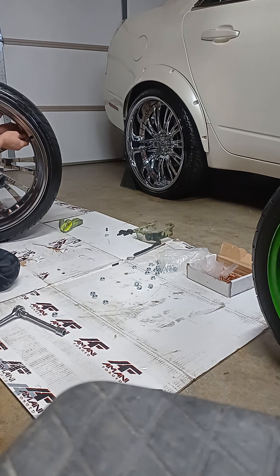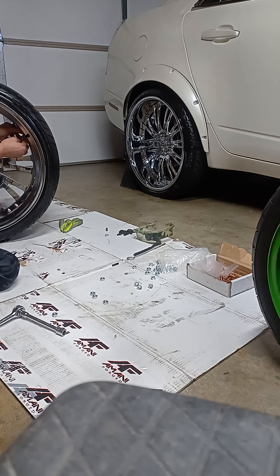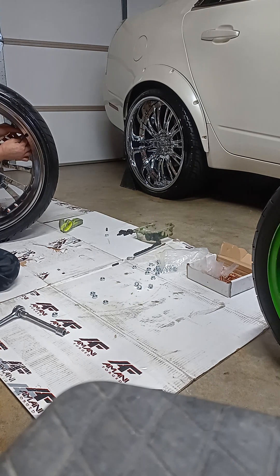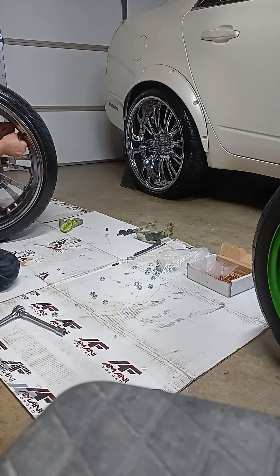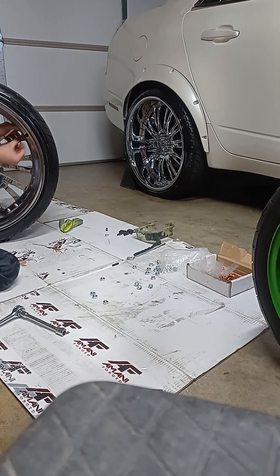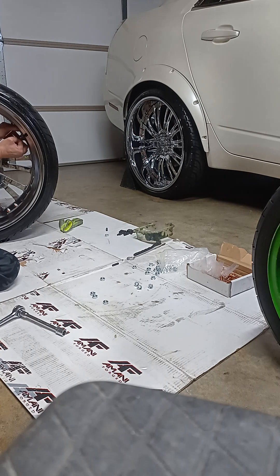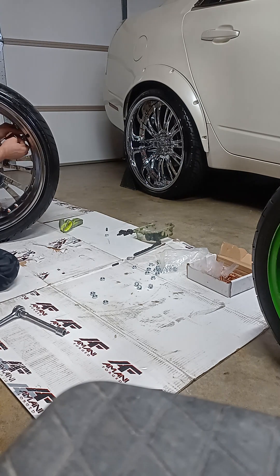These are old wheels — good-looking, but old — and there was a lot of corrosion in there. It's hard to overcome that if you actually drive the vehicles. So that's all you want to do with that one. These nuts are reusable but you always want to get new hardware. Some are flat on the end — serrated or flat, you don't necessarily need serrated on this end. Just tighten it on by hand as far as you can.